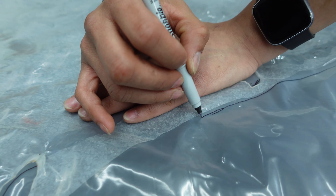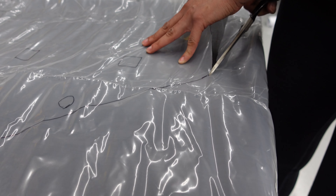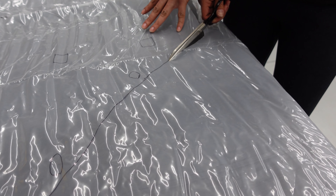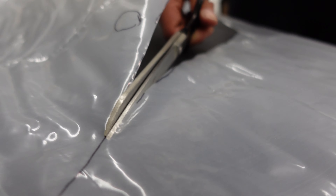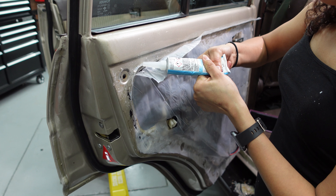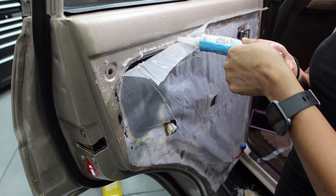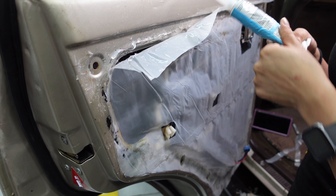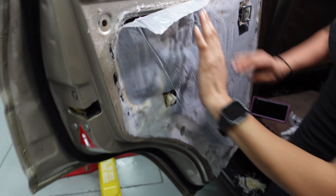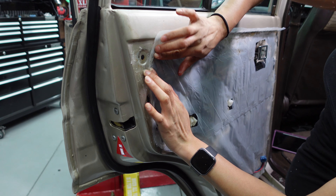When we took off the moisture barrier the pieces were pretty beat up and it's a very thin material, so putting it back on wasn't going to work. We're using painter's plastic and the original pieces as a stencil — Fanny is carefully cutting an exact fit match. We picked up silicone material, similar to what was already on there. It's a good material that serves the same purpose. All the sound dampening is inside already and it came out fairly clean.